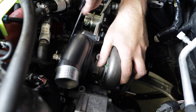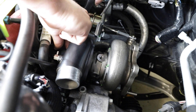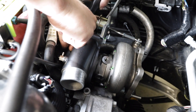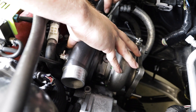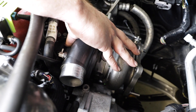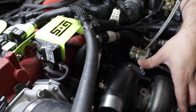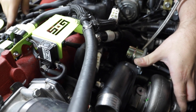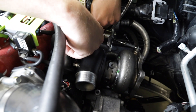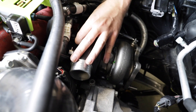Find the included NPT oil line adapter and thread it onto the oil line. Now find the included braided oil line and thread it onto the adapter. We're now ready to drop the turbo into place — take your time and get everything lined up. This part can be a little bit tricky, so take your time. You can use a screwdriver or a pick of some sort to try and pull the rubber inlet over the compressor inlet, but be careful — the last thing you want to do is puncture a hole in the rubber inlet. Once you have ensured that the turbo inlet is on the compressor and the oil drain hose is connected, pull the spacer that you used between the intake manifold and the turbo inlet. This should give you the space needed to further press the turbo into the inlet to ensure you have a strong connection.